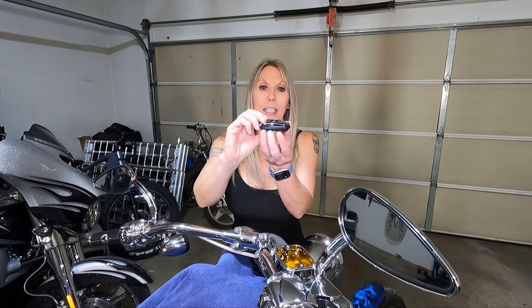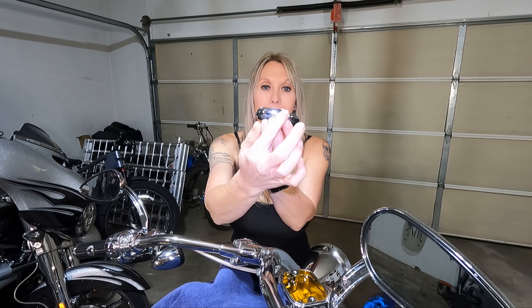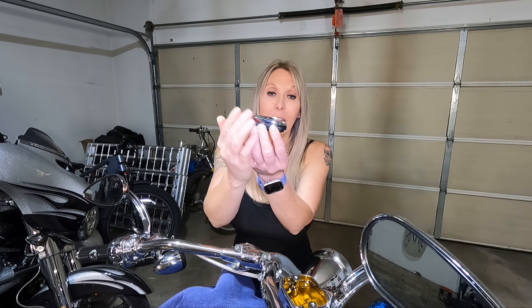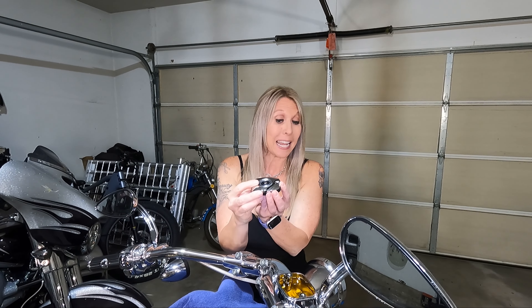I have the new cover in my hand — hopefully you can see it. It has a thick edge down here and goes a little thinner. When you take off your previous cover, pay attention to those details so when you put it back on you have it correctly oriented, and it'll seal the way it needs to with no future leaks. I know my cover needs to go on like this. The next step is simply to put on the cover, tighten the screws back up, and this cover is replaced — hopefully no more leaks.